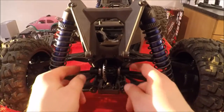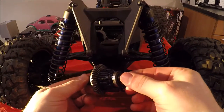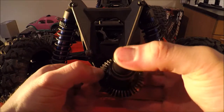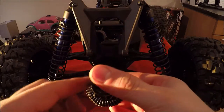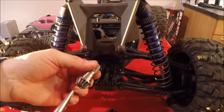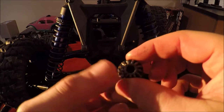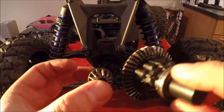Let's try and remove the front differential assembly. Oh my goodness — straight away I can see that there's one tooth missing here, half a tooth missing there, and one missing here. That's why I'm getting clicking and snapping sounds from the front. Let's have a look at the pinion gear front assembly as well. Okay, it doesn't look too bad initially, but — holy smokes — there's a tooth missing just there. So it confirms my suspicion that the front ring gear has gone and the pinion gear as well. We'll replace both of these.